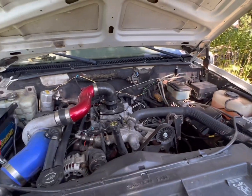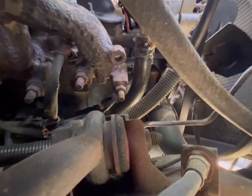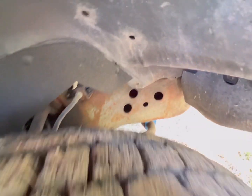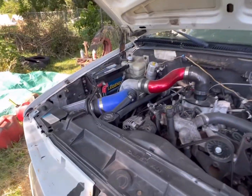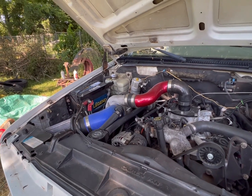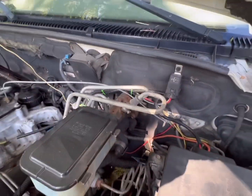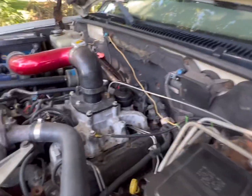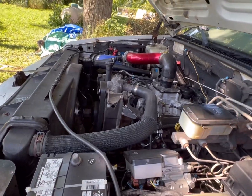There are some important grounds, especially being glow plug and battery related, from body to chassis. There should be one down here that runs up to the chassis of the truck and up to the cab firewall. My big new power cable comes down through those eyelets and down to the starter. Make sure that doesn't have burn spots, wear-through, or any kind of damage, because what you'll end up with is a master power cable that shorts and causes a thermal runaway effect. If you've got a PT Wiring Solutions or Zombie Solutions lift pump harness from Bruce, make sure it's grounded well so that lift pump runs when it's supposed to and not when it's not.